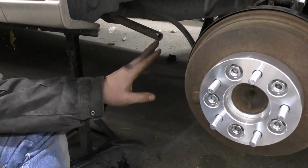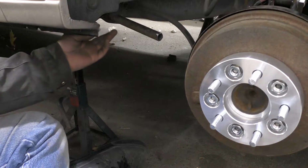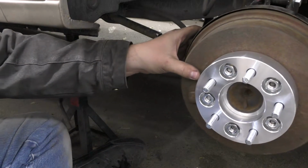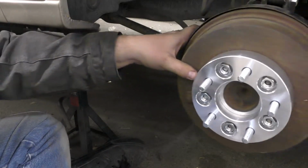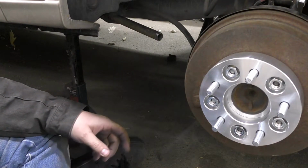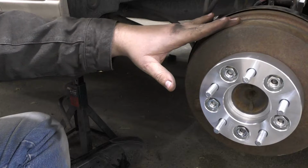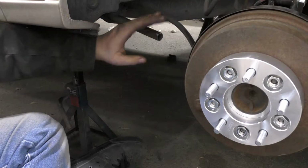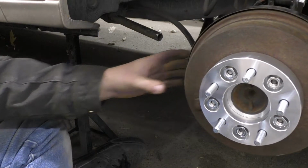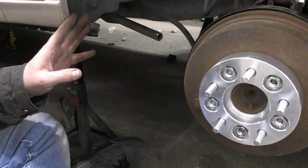Alright, so down here you can see I've already hacked away the trailing arm. But the trailing arm comes from the mount up here to the bottom underneath the knuckle area. And that locates this guy forward or back from where it should belong. So, the problem is because we put 2 more inches of lift here, it then increased the angle of this guy, which then drug this forward. And that makes it so there's not nearly enough room for tires up at this front area.